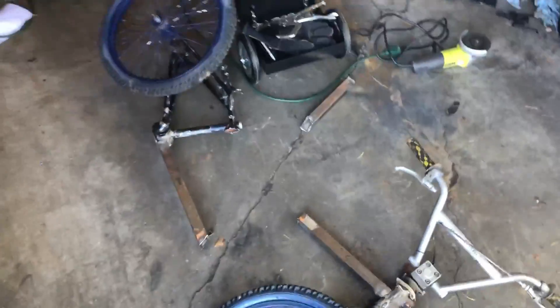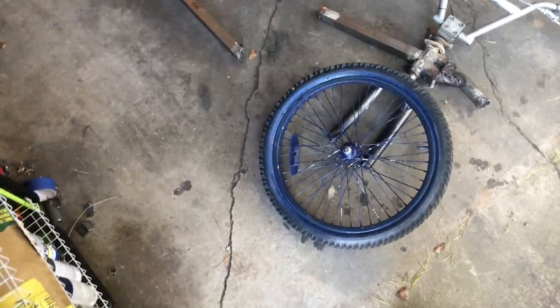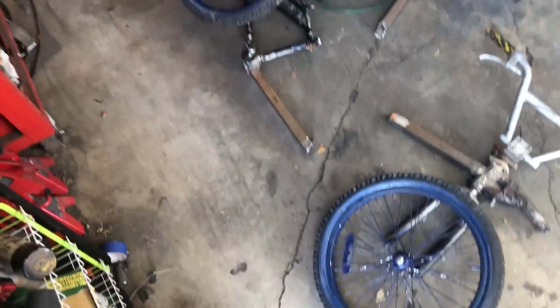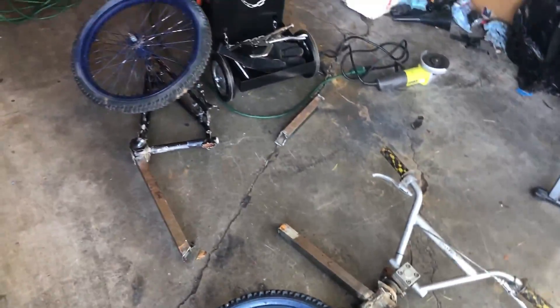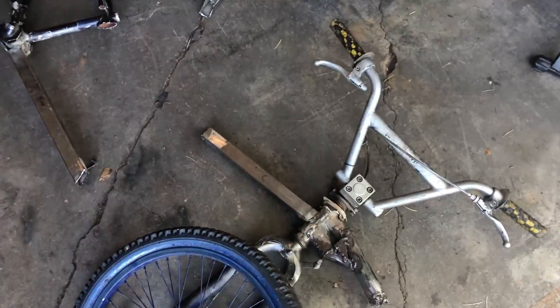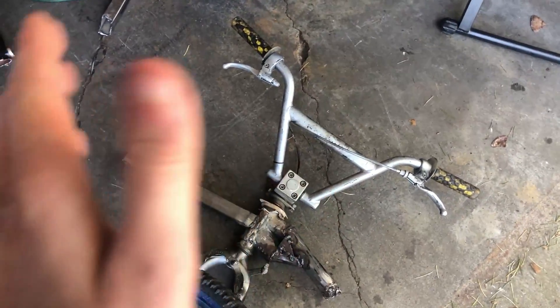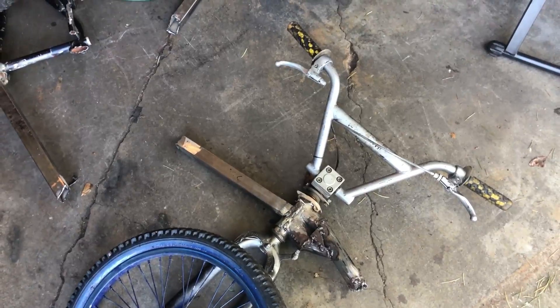So this is the ideal shape that it's supposed to be, ideally. The reasoning that it wasn't like that in the last part was — I had the correct rake when I built the tube frame, but then when I added the steering component that hugs the fork, it changed the rake. Now I have to make this a combination anyway.